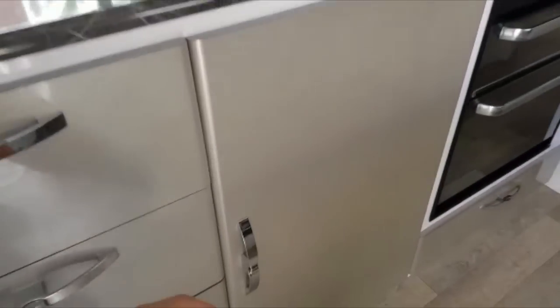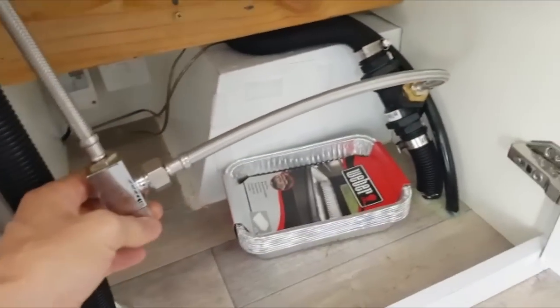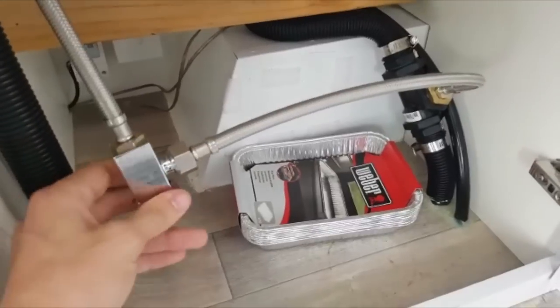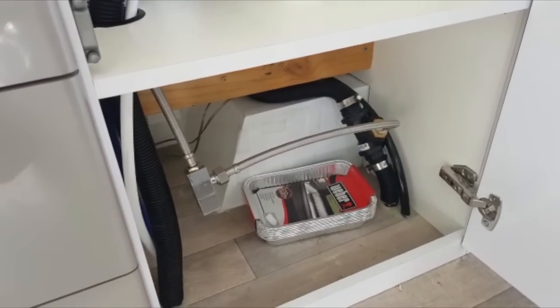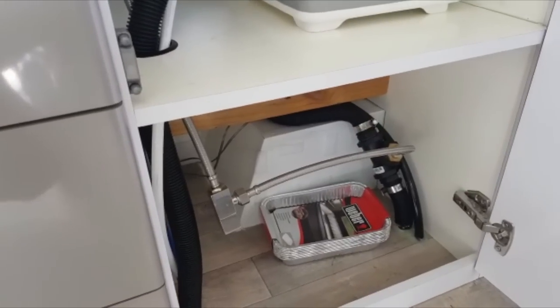This one really surprises me that it's not a more standard feature in caravans. All I've got is a water line coming off the cold with a tap on it, plumbed into the inlet of the water tanks, so whenever we're connected to mains all I have to do is turn this on. Saves you from having to disconnect your mains or get a second hose out just to fill the tank when you might be sitting there for 24 hours anyway.